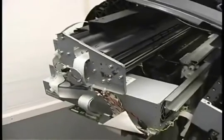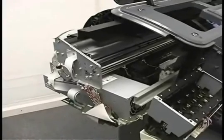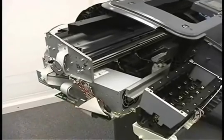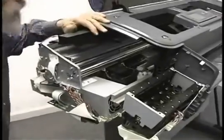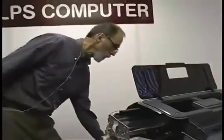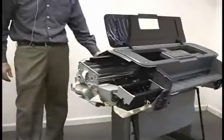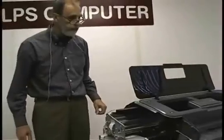Okay, that's about all there is to that. Now, I think we're about ready to put the covers back on, and we can run the calibration. So I'm going to go ahead and put the covers on. The procedure there is the exact opposite of taking them off. When you slide them on there, they tend to clip onto these first, and they'll stay in place. And then just remember where the screws came from. One underneath, the hidden one in the front, one in from the back covers, the hidden one up here, and I think that's about it.